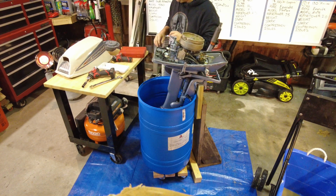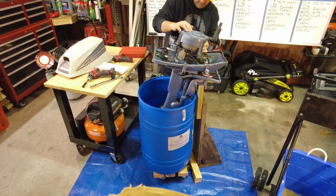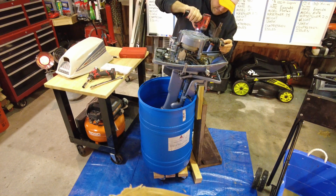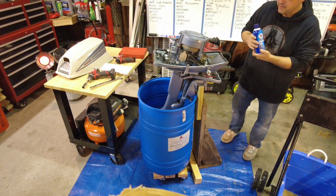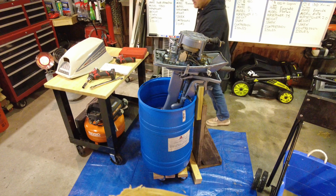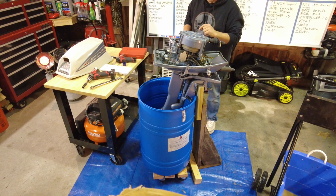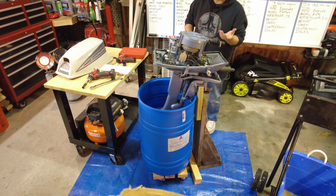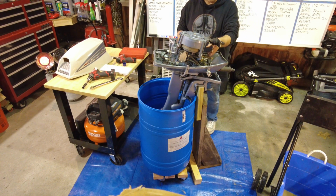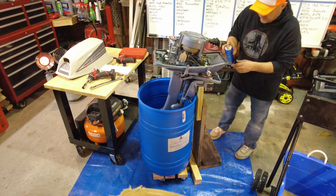Okay, that's back together. Let's put the pull start on. This is kind of cheating with starting fluid, but if we can get this thing to turn over a few times, it'll be a small victory for Parts Canning Garage. And then at that point, all we really have to worry about is fixing that impeller and maybe cleaning the carb, which, if I have to clean the carb, which it looks amazing, it should be really easy. It's right here. 2 bolts and it's off.